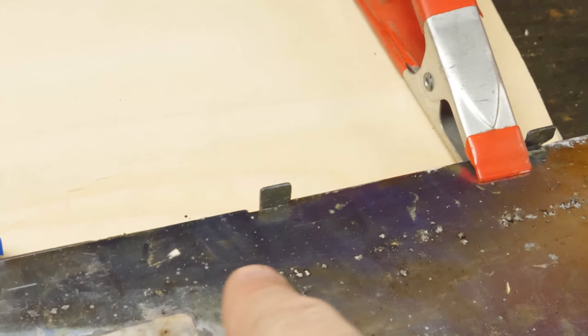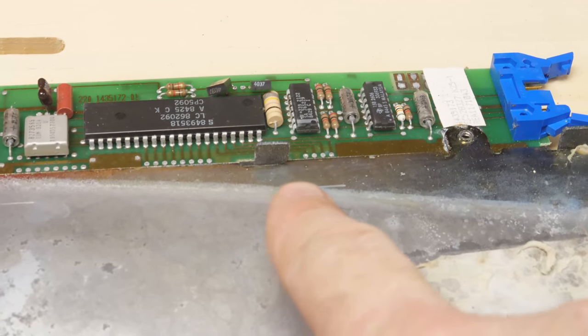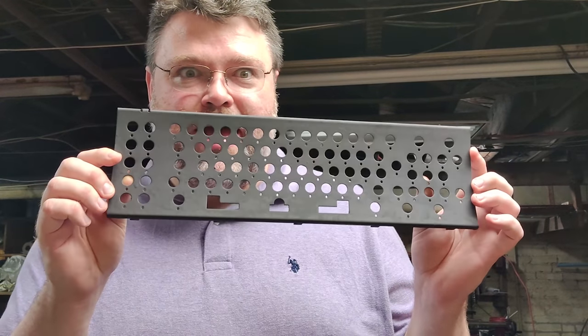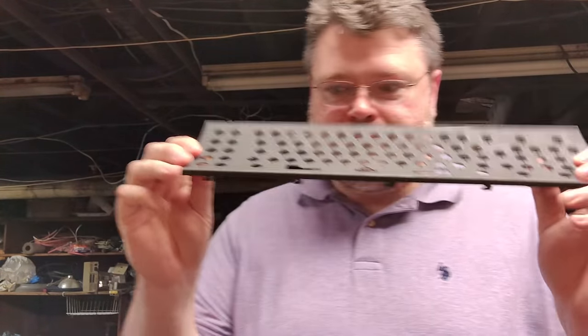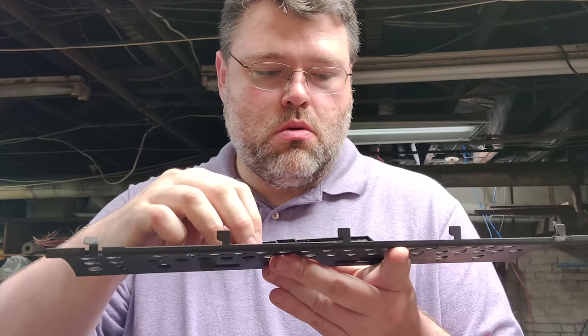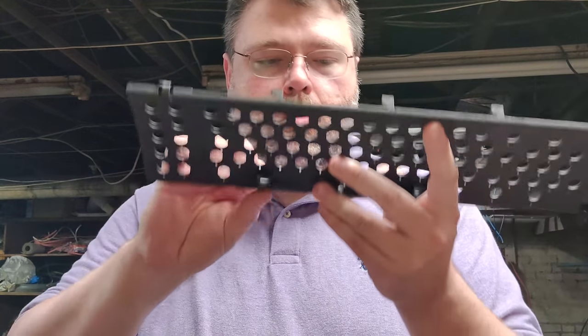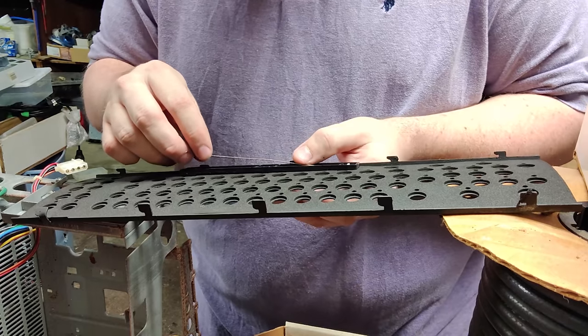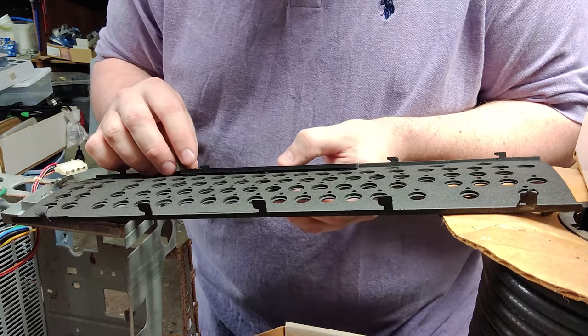Just go slow for the reassembly and be patient. It is possible to mess up your circuit board or some flappers. Get the neoprene pad ready — the space bar is the first key I want to install. The space bar is really tricky, so be extra careful and add the spring wire. You can get it in upside down, so be aware of that — you don't want to put it in upside down.